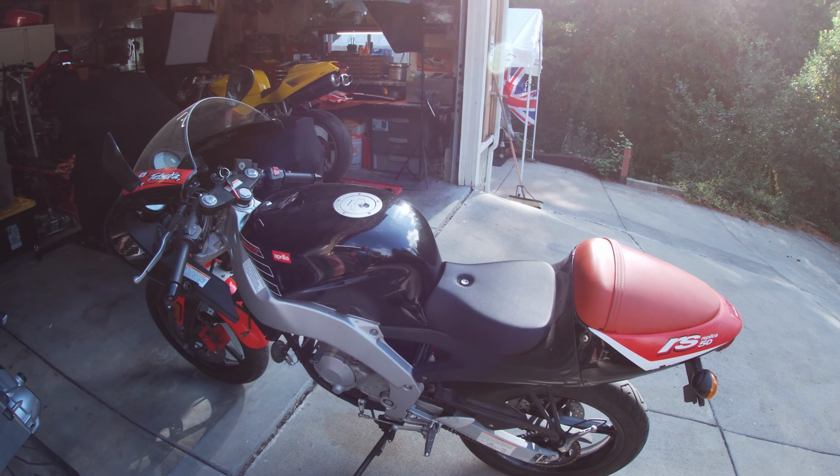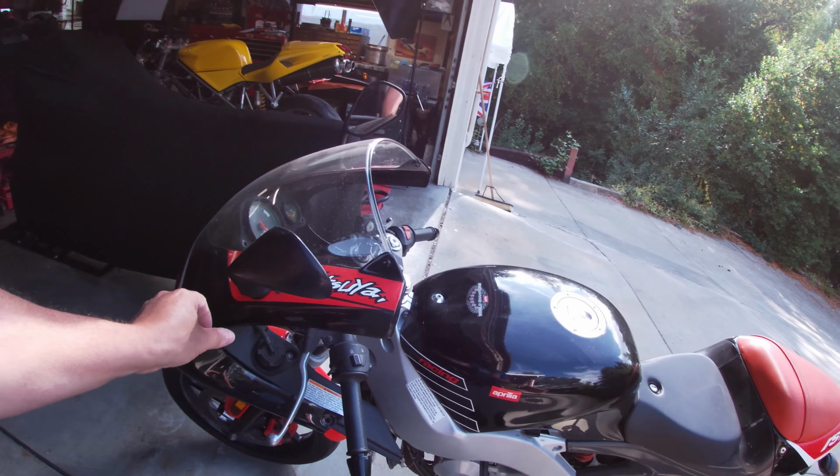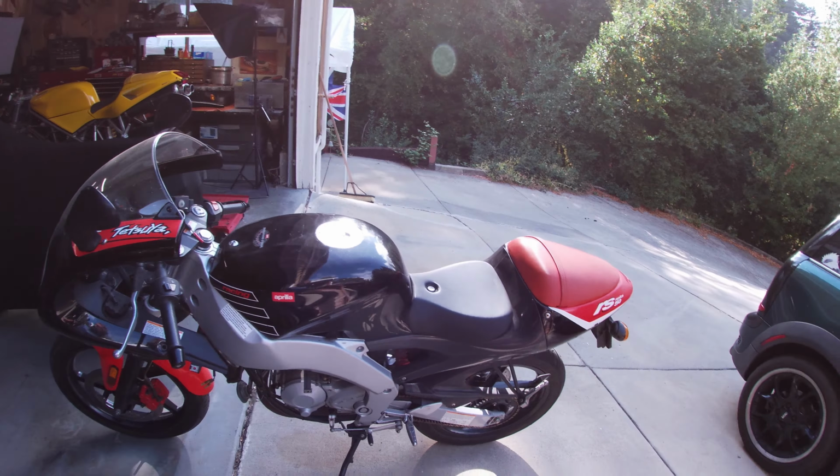I'm hoping with the tank, like we've done on some of the other projects, we can just cut the original clear coat back a little bit and then buff it up. There might be a few areas, I can see here, that are maybe just decal damage, hopefully. So the tank looks good. We don't have to do anything major there. Yeah, so I will do paint correction on all the panels, even the ones that I'm not repainting. So we'll make it look like new.